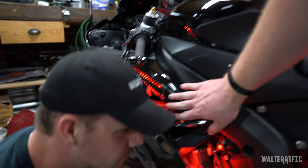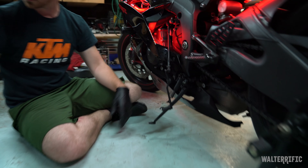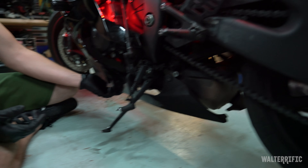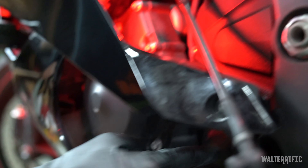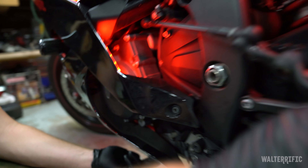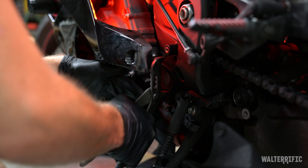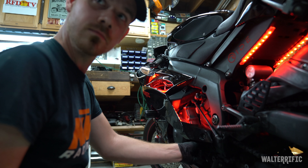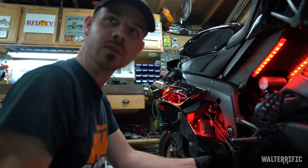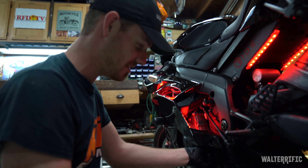I thought we'd have to rip off this whole side piece, but Reed was like, nah, we can just disconnect the bottom and pull it out — like you just did to get to the drain. There you go. You can get to the drain, and there's the filter right there. You can pull this up and it'll get exposed. He had to disconnect it, but look at that — you're able to get it loose with just that clamp tool. That's lucky, because in the past oil filters like that have been just stuck in there. On one of your bikes we had to do the screwdriver trick where we pierced it and pried it off.